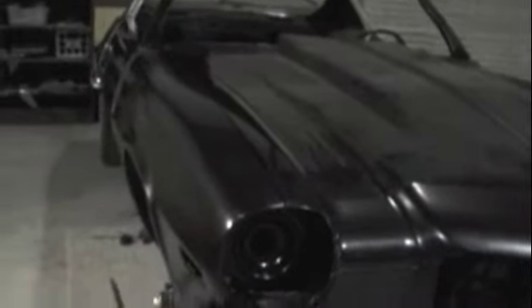We've been doing some measuring and looking at the front end, where the adjustments are down on the front and where there's an exact bow spot in both of these fenders in the same exact line. Right here in this fender in this section, and the same with the other — you see it even in the front, raised up right here, and then it's even back here. That's the same on both sides. What we're worried about is it got cranked down in the front and might have bent the fenders right on both sides when putting the front end together. We're gonna take all this front end back apart and re-line it up. We're measuring out things with the fenders and to the hood — if you get one side you can't get the other.